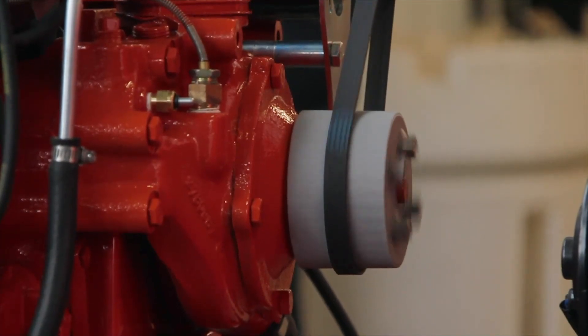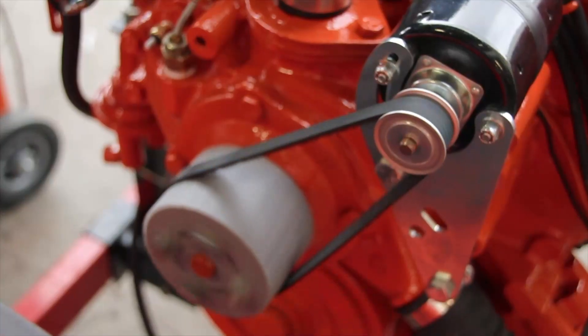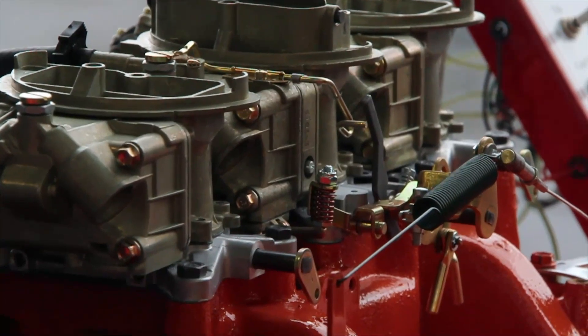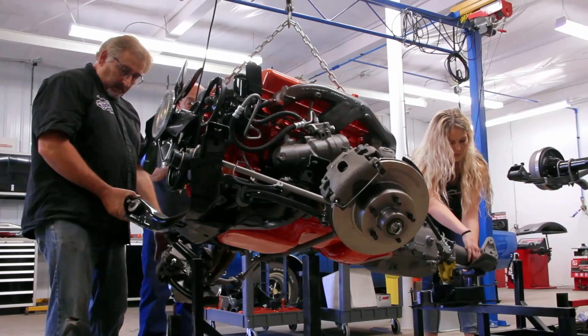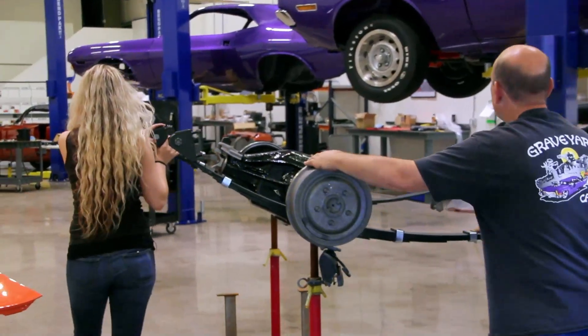I'm considerably relieved that we didn't have any kind of internal problems. You always run the risk — you've just had an engine completely apart, which has hundreds of parts. You have rod bearings, main bearings, cam journals — they all have to be mic'd, they all have to be plastic-gauged. These are within thousandths of an inch; your eye can't even see it. With all the assembly built out and the engine running good on the engine run stand, the detail work done, we are now ready to install the 440 six-pack with the K-member and suspension in the front of the car and the big 3:54 Dana in the back of the car. Driveshaft in the middle, a couple exhaust pipes, and you got yourself a drivetrain.